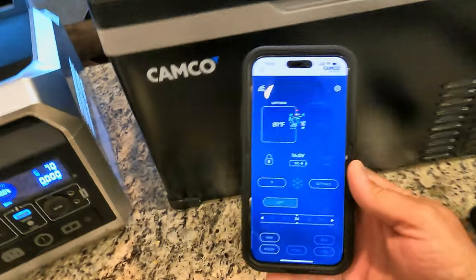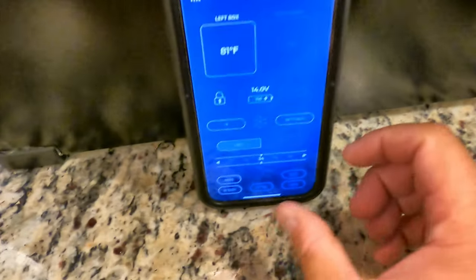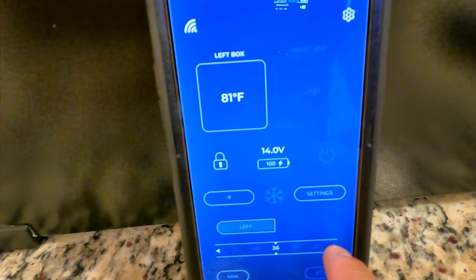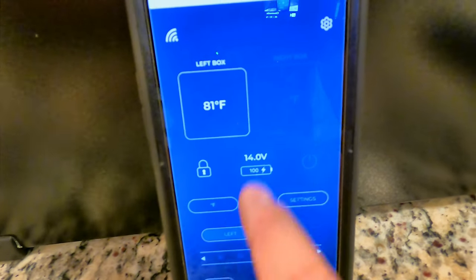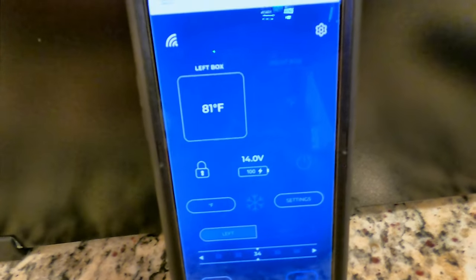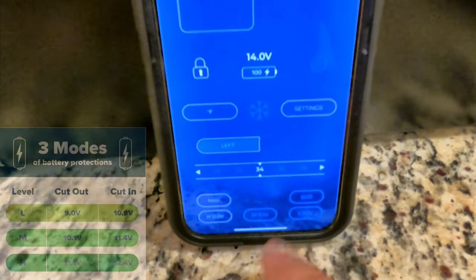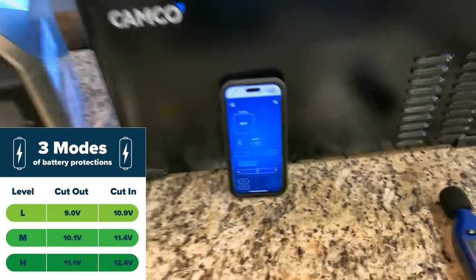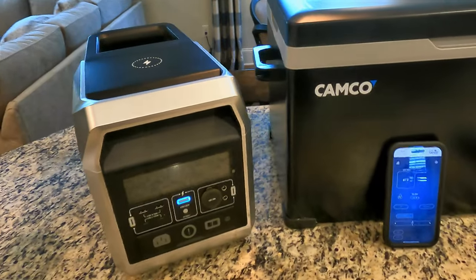It comes with a little app. So if you are cruising down the road and you're not sure if this thing is cooling, you can use the app to control what's going on back there — move your temp, and you can actually hear the cooler responding as I'm hitting these buttons. Right now it's telling you it's 81 degrees; I just plugged it up. It takes about 45 minutes to cool down all the way. You've also got max mode and battery protection settings — high, medium, and low protection depending on your situation. If you've got a deep cycle battery, maybe use low protection. If that's your only battery and you've got to get out of the woods, maybe use high protection.